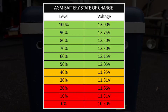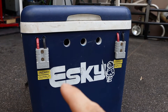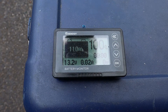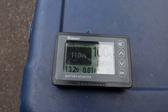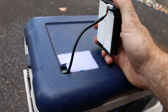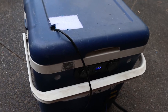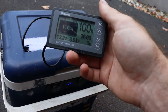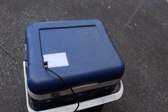It's good practice to keep your batteries topped up at 80% or higher and never below 50%. On the back side we've got a secondary output for the inverter, and charger input for a trickle charger or solar input. On top I've got a battery monitor — you input the specs of your battery like amp hours and volts, and it'll monitor what percent your battery is at and how many amp hours you've got left. It can also set an alarm to warn you when your battery is getting critically low. I've mounted it with velcro because the cable is four meters long, so you could pull it out and mount it remotely — great if this is in the boot of a car or a caravan. Being velcroed also means I've got access to the back of it to unplug it and take the lid off for maintenance.